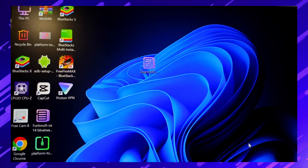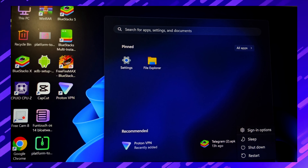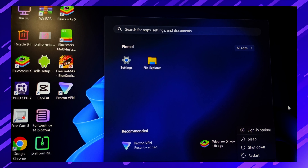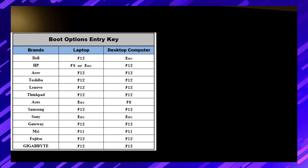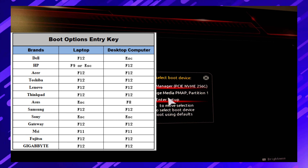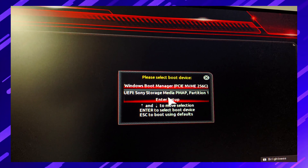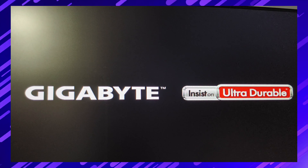After the process is complete, simply click Close. After that, power off your PC or laptop. Start your PC and enter the boot menu. I'll show the boot menu shortcuts on screen. In my case I have a Gigabyte motherboard, so I press F12 to enter the boot menu. Simply select your pen drive — you can see UEFI Sony Storage Media. Select that option.